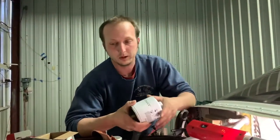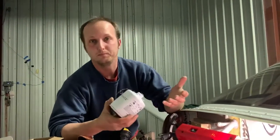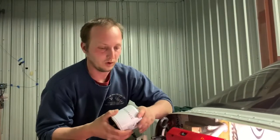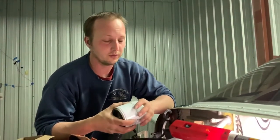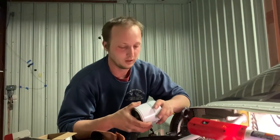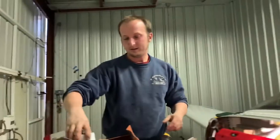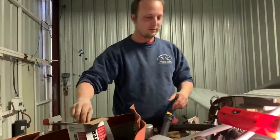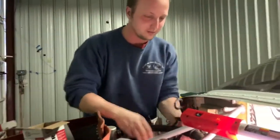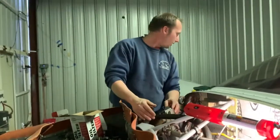We'll put some engine oil on the O-ring, install the filter, torque it, then safety wire it — a little different order than their steps, but that way we don't forget the safety wire. Then we'll pull the airplane out later and do a run-up to check for leaks. The big thing is to always make sure you check for leaks — you don't want to find one when you're up in the air. You can't pull over and go to the auto parts store to fix it.